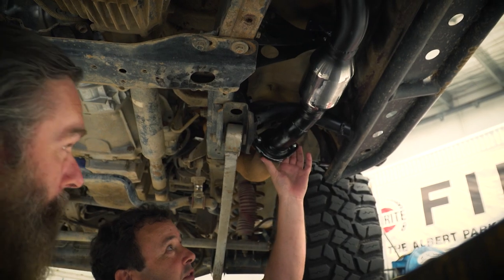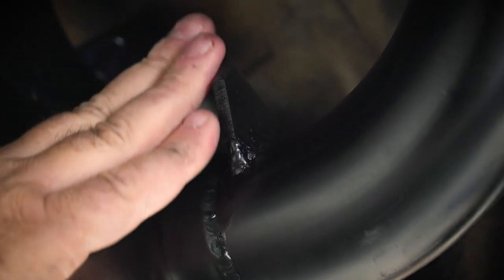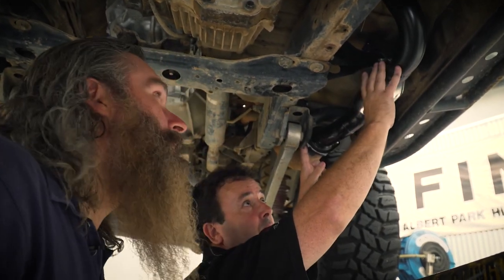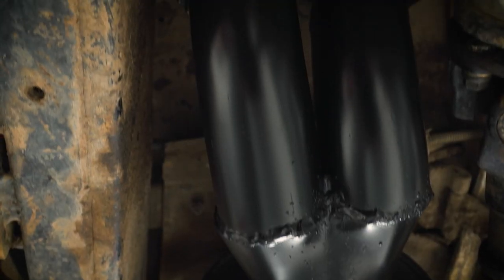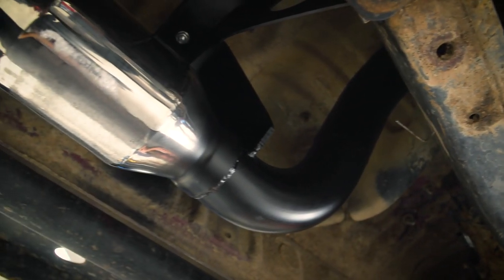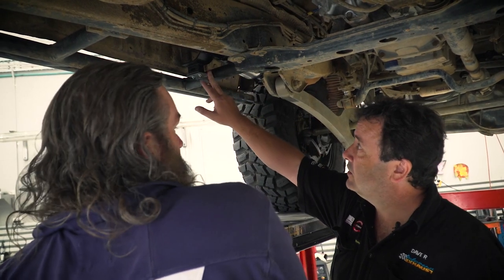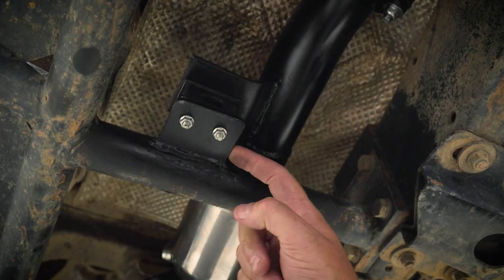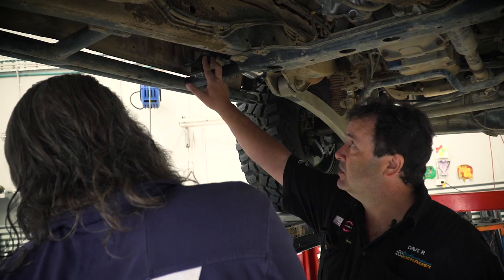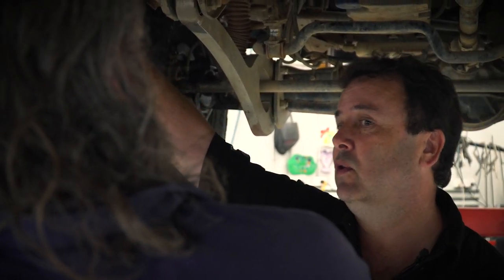As you can see Danny, we've got the flange plates here with gaskets and bolts. And then we've made some heavy-duty bracing around the cat assembly with genuine Toyota mounts. So if you have any issues off-road or anywhere around Australia, you can buy the mounts — very straightforward for parts. We've also put another flange just here and made that section unboltable, so you can remove it if you want to do any maintenance or replace that section. Because we mirrored it, we've had to make custom mounts off your side rails. So we've made the plates, put the Toyota mounts in, and made a big brace to your exhaust system. It's all braced up, secure, on really good mounts — it should handle all the off-roading you're going to be doing. Nice and neat and all tucked out of the way.